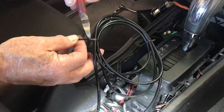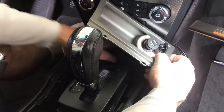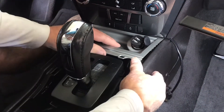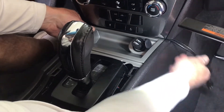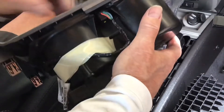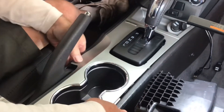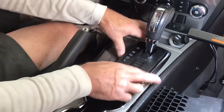Originally I was going to run the cable on the edge of the car near the weather stripping at the bottom of the doors where the plastic kick panels are. I did remove one panel but it was really tight with a ton of wires in that location, so removing the console and the rear seat I think was easier. Here I wedged the wires in the front panel joint that holds the power point — I'm not too concerned about damaging the cable since it is brand new. As you can see once you get everything in it doesn't look too bad. Reattach the electrical connector on the cup holder, start at the front beside the power point panel and work your way to the back making sure the clips are engaged. In the power point connection you can see the adapter which will allow you to hook up two USB connectors — one for the front camera and one for the rear.